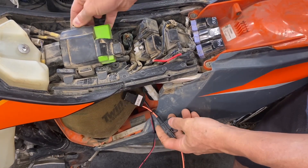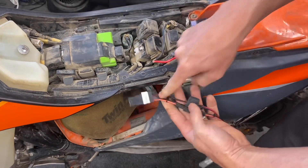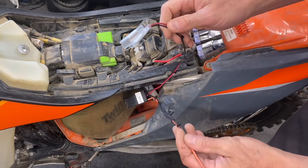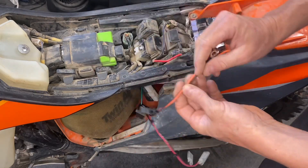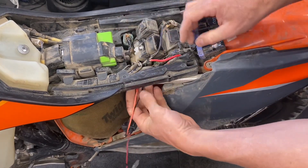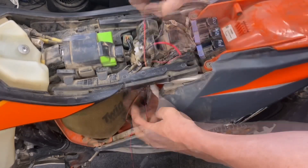The ECU can go back in its place — you're not going to have it connected to the bottom anymore, obviously. The relay is going to be here in the airbox, and then this here is for our accessories. This goes to the battery cable, so you're just going to find some area in front of the battery here to feed this up.